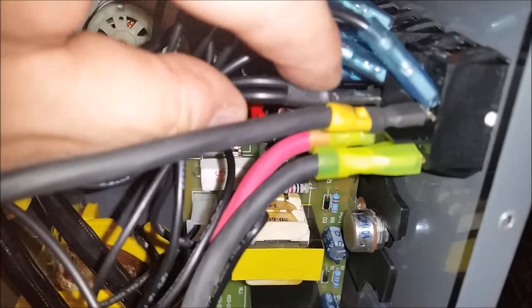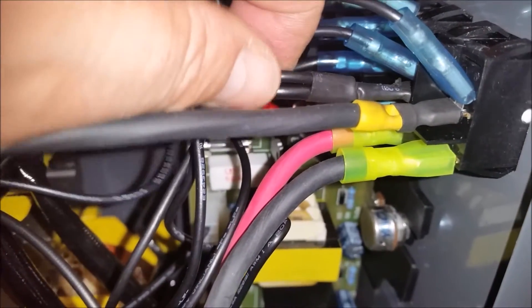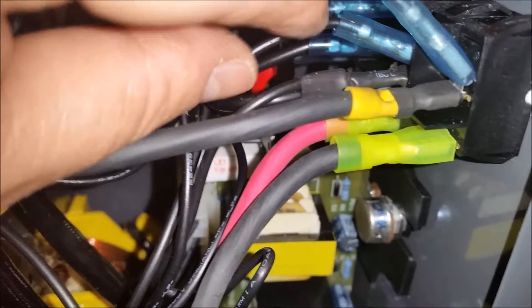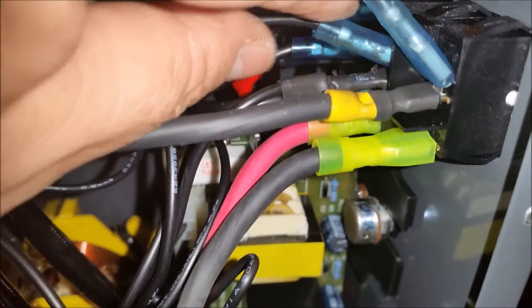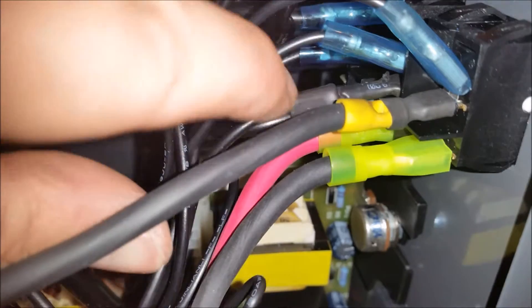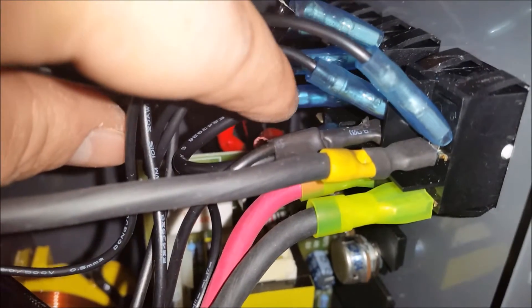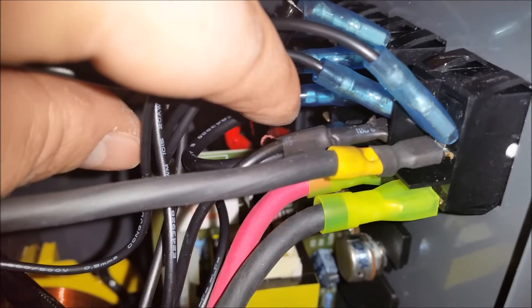Notice this one actually has two wires on it. So what we're going to do is take this wire off of here and connect it over here — we'll put another crimp on there, a blue one. Then this one will just be a regular straight piggy jumper going over through the minimum/maximum switch. Let's get this one off and I'll show that to you.